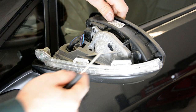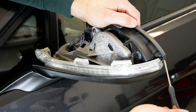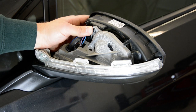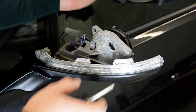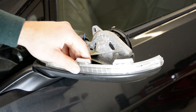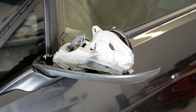This plastic stays just in this clip — you need to push left and right to remove this plastic piece and take it away. It's better to remove it this way because the blinker goes inside this plastic. Push on these two tabs — they are very strong tabs — and it comes out like this. Two screws and one clip here, and after that you take this away. And this is how you remove your blinker, your mirror cover, and your mirror glass on your Golf 7.